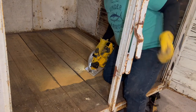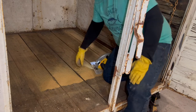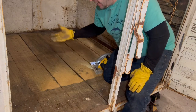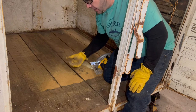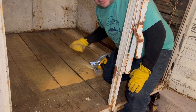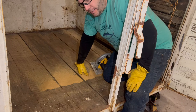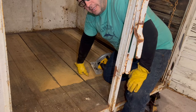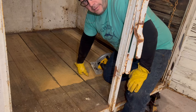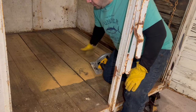That's the first row — now we're going to make another cut and these boards will come out. If there are carriage bolts in there, you'll cut in between, have gaps there, and be able to come back with either a pry bar or a baby sledge and hit those, then cut your carriage bolts out with your grinder because most of them are going to be rusty. We don't have carriage bolts in this one, so I'm going to go ahead and keep cutting.